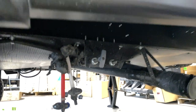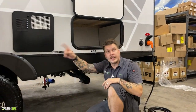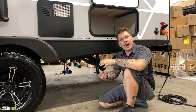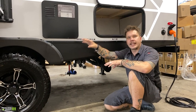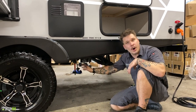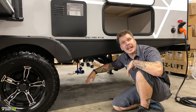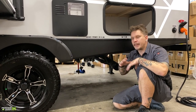So to do so, what we're going to do is, number one, we're going to drain the freshwater holding tank if it's been in use. That is what we saw up front, just removing that plug. That's going to be a gravity feed system that'll take care of the freshwater holding tank. We can then come here to the low point drain. These have physical valves, so all we have to do is open those valves. Once we've opened up those valves, this is again a gravity feed system. It's going to drain all of that point A to point B plumbing.